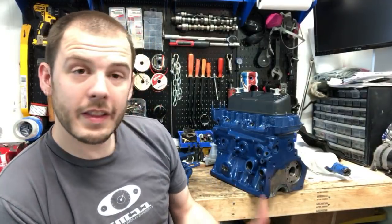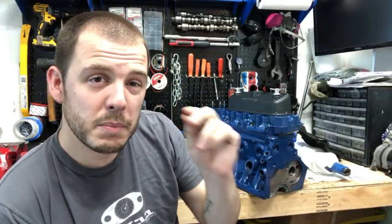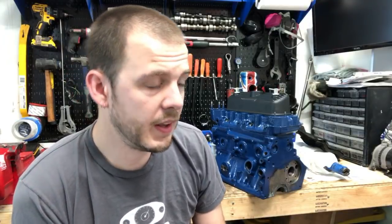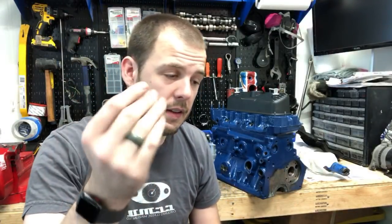Megadite says, I treat steady bushes as a service part and change them often. They are less than $5 and engine rock on a Mini just provokes other mountings to fail. Agreed. One of the things I kept trying to figure out was why my drive shaft was failing, and it was simply the bottom engine mount. The rubber had failed, and I just didn't see it. It looked like it was good. So that's a perfect example. If your steadies start to fail, other stuff starts to fail, just because things aren't supposed to move all over the place.